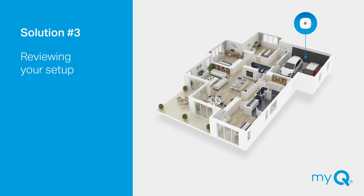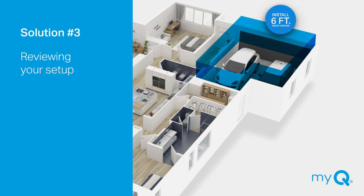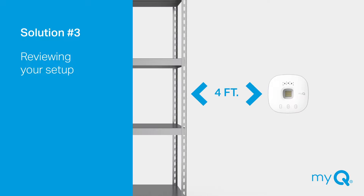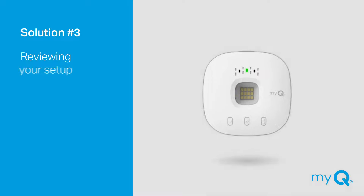Change the location of your MyQ Hub. Find a location in your garage — either on the ceiling, side wall, or opposing wall to the garage door — that is at least six feet above the ground and near an electrical outlet that you can plug into without an extension cord. Avoid placing the hub in a cabinet or within four feet of any metal objects. When your garage door is being closed using the MyQ app, the hub beeps and the LED light flashes to warn those in and around the garage. Therefore, the hub and its LED light must be visible at all times from within the garage.